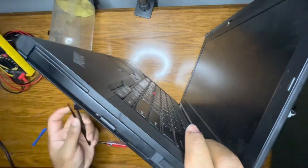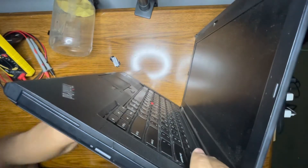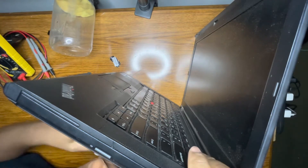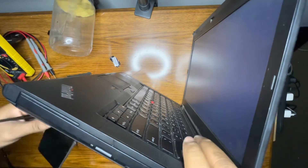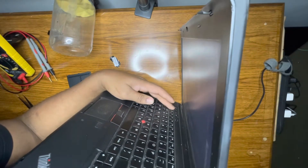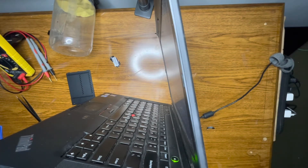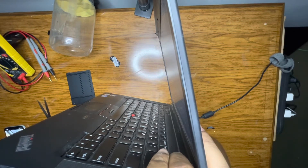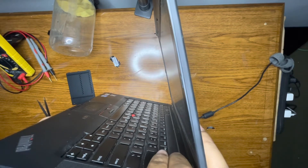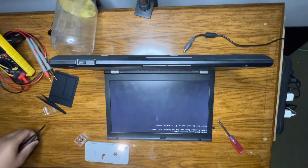When I first started this, it took me probably about 10 tries to get it right. What you want to do — what I did — was get my tweezers ready to go into the hole. I had one side of the tweezers in one point of the hole, and the other side of the tweezers ready to be inserted into the other hole, like less than a millimeter gap. I turned it on, shorted it, and started tapping F1.